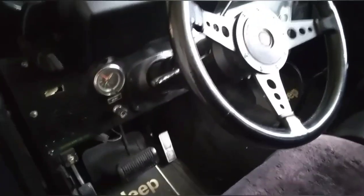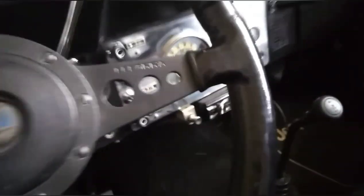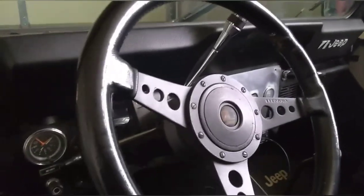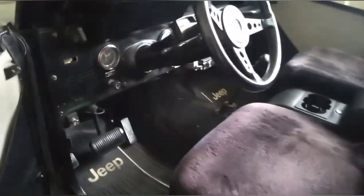I was going to wait until it's warmer — it's still March and in the 30s — but I went ahead and pulled off the dash, laid the windshield down, took all the bolts out, and pulled the dash out. I had ordered all new heater cables, so all those cables are now new. The switch is new too. I also took out the clock, which you couldn't even see before, and buffed it with rubbing compound so now you can see it again. I found one lone wire hanging down below the motor in the engine bay, hooked it to the heater, and when I got everything put back together all three speeds work with no leaks — it works really well.